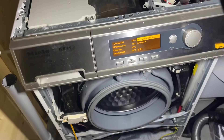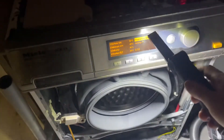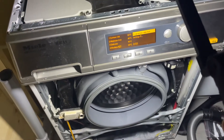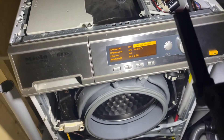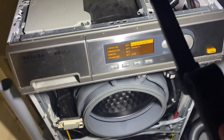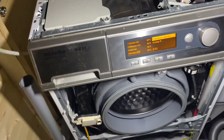Changing the heater rating is normally something I'd never advise doing on a domestic washing machine. However, with this one, the default heater rating setting is around 5,400 watts and you can turn it down if you want to. It has a bunch of different settings.